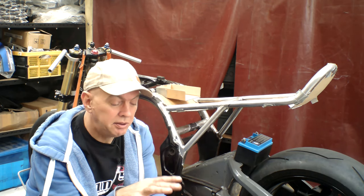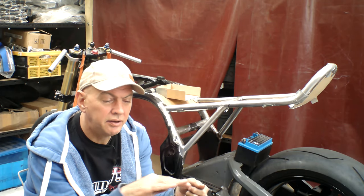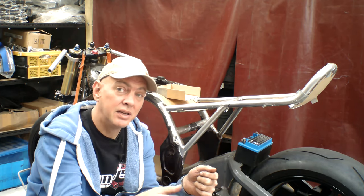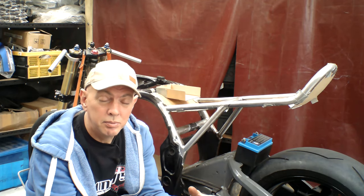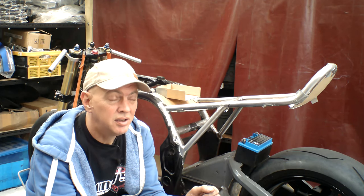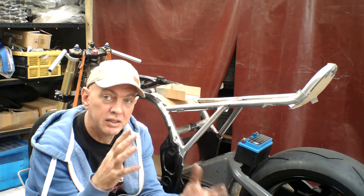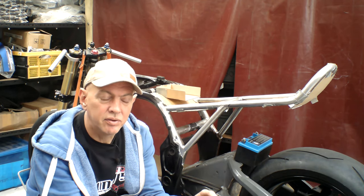But an English wheel is supposed to be rigid so that when you're rolling it, not only will it curve it to the shape of the lower anvil, but it will also curve it that way along the diameter of the wheels. But these little rubbishy ones, there's so much flex in them, it doesn't curve it that way. So it's not really that good. If you want it just to curve in one direction, you're supposed to put a rubber band around the top wheel. That cancels all that out. So then you're just working on the anvil shape, which is cool.